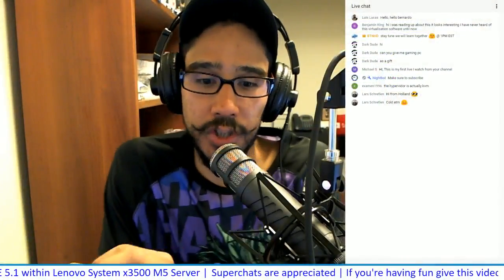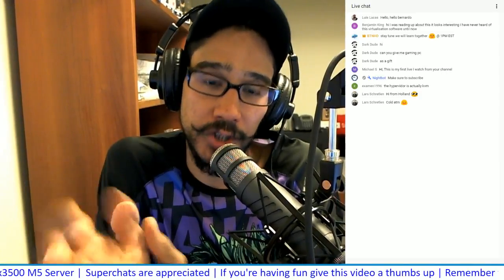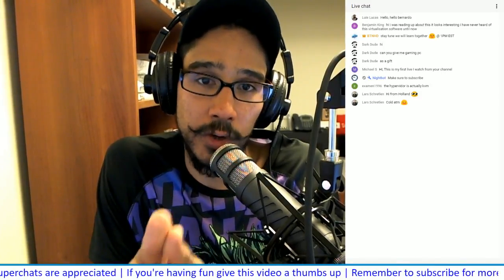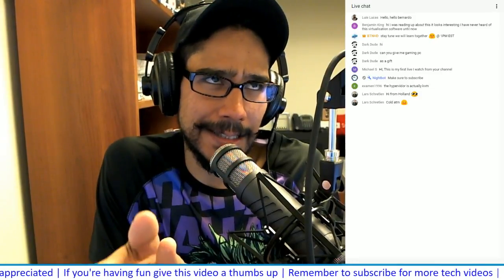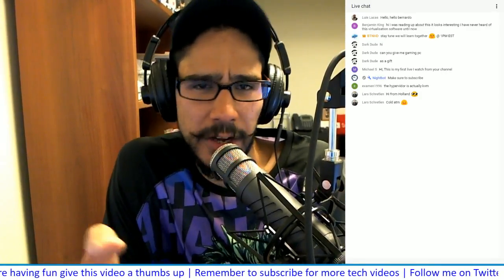So what we've done so far is we are taking advantage of the Lenovo System X3500 M5 server. Behind the scenes, I showed you guys a video where I did a RAID 5 configuration on all 4 hard drives. I have 4 256 gig solid state drives, I think, so I did a RAID 5 of them, a total of about 700 gigs.